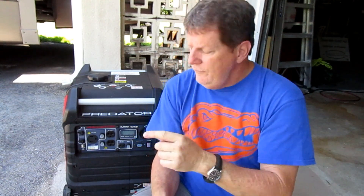When I put this into storage last year, I did a couple of things: it had a full tank of ethanol-free gas with some Sta-Bil in it, and it had fresh oil because I'd just changed it. But before storage, I drained the gas out of the carburetor — that's an absolutely essential thing to do on small engines. If you're going to store your generator for longer than about 30 days, you must drain the gas out of the carburetor. This model doesn't have a fuel shutoff switch, but there's a little screw on the bottom of the float bowl you just loosen and all the gas drains out. I actually did a separate video on that. Before we even turn the gas on, there's one more thing to do.